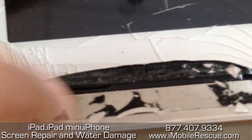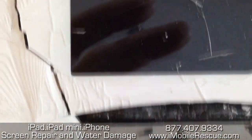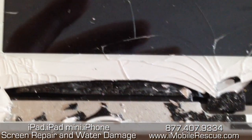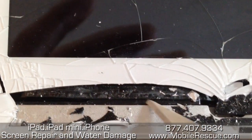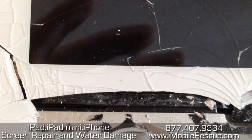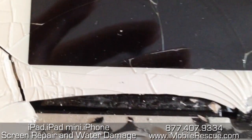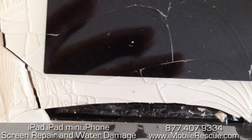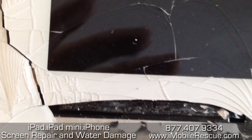But mainly we're talking about this home flex cable. It's a little ridiculous, and basically what you have to make sure you do — watch how it goes and make sure you don't cut it. Don't use an X-Acto knife anywhere near it. Don't use an X-Acto knife here, don't use it up here. You can use the X-Acto knife down here. Make sure you heat up the entire area really, really well — but not too much — good enough so you can just peel the glass away easily. And go in really slowly, carefully, and deliberately. Have a sharp X-Acto knife.